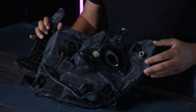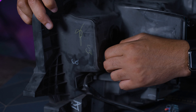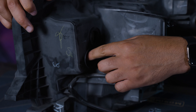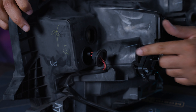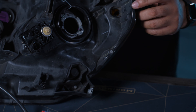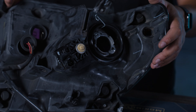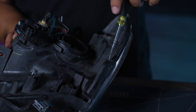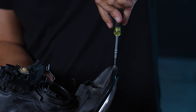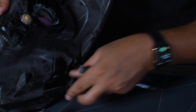That releases them — move them to the side. Make sure not to miss any of them. I'm going to remove the grommet here. Keep in mind there is still wiring that goes in the housing, so we'll come back to that. There are screws all around the housing that you need to take off. We're going to get the Torx bit that fits — it is a T15 — and start turning to the left to loosen everything up.